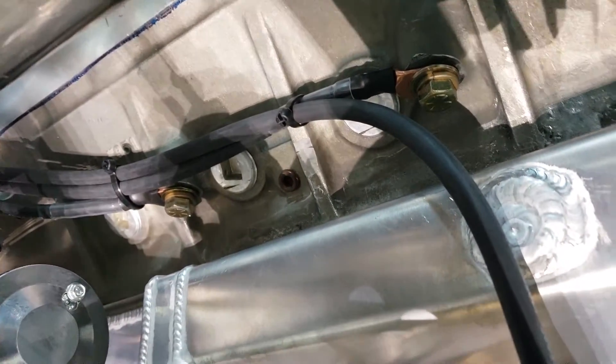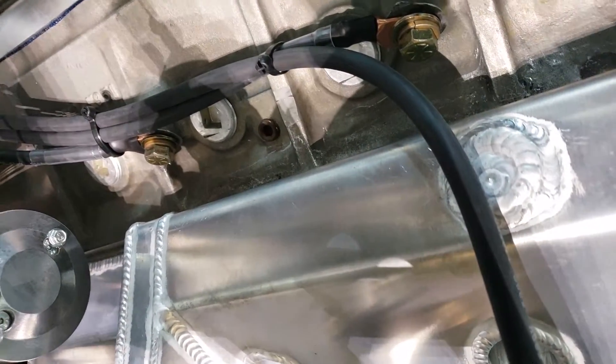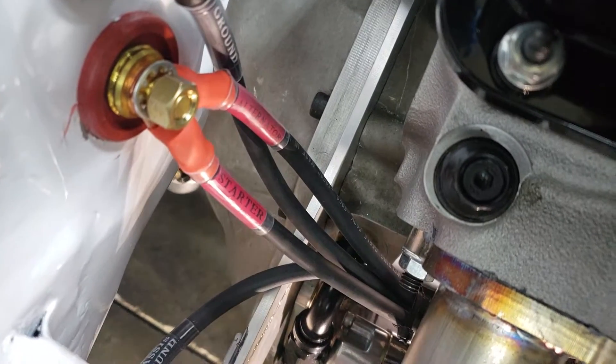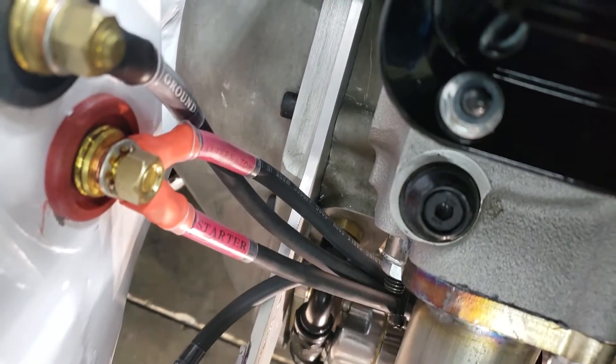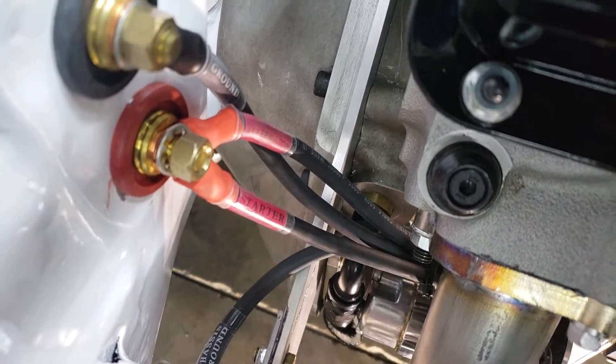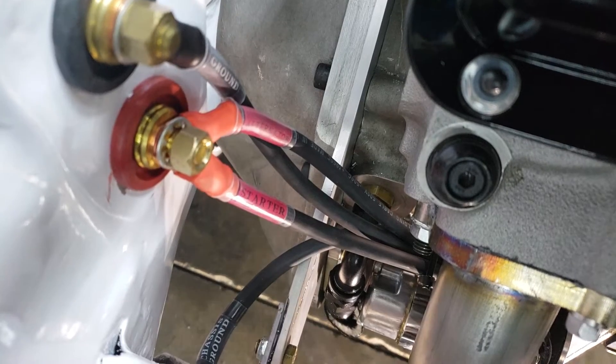I always do this — you can debate it all you want. The way I do this: I grab the motor mount holes on a Ford — the LS has got them too, but there are two different locations. One goes to one hole and one goes to the other. Then for power, we've got a lead for the starter and a lead for the alternator, and again that's going to go straight back to the battery. Argue amongst yourselves, but this works and it's never given me any problems.